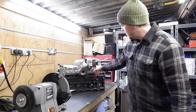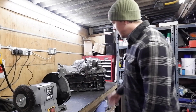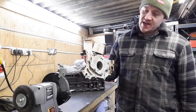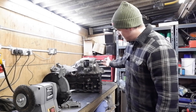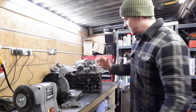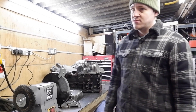That's all cut out. They also cut this centre section out, so I did that on both sides and then ground back some of the casting so it's clean metal. I've brought a scrap block - it's flat on the bottom so I can bolt it all up to that and it should stop it from warping. I also had to get an oil pump because it kind of holds the front down during welding. I'm going to put the diff and the quill shaft in there just to keep it as held as possible - I'm mostly worried about the diff bearings moving a little bit.